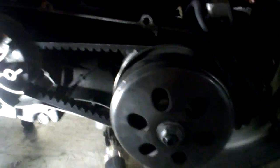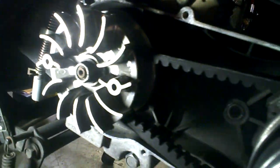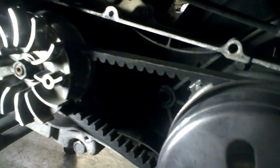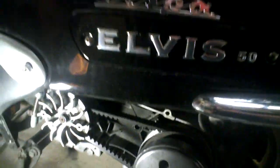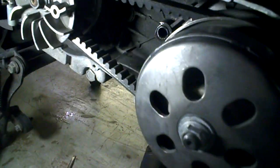Now if you open this up and it looks similar, but it's a 150cc and it's a liquid-cooled engine, it's going to be a CFMoto 150. Even the CPIs and the Italjets with that engine are the 150 by CFMoto — those are V-Charms, E-Jewels. There's also the United Motors Type-C, which is a totally different block, but you wouldn't see any difference here; you would see it in the cylinder. So that's how you tell the different types of engines on your scooter.